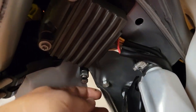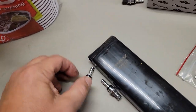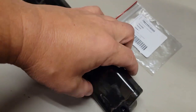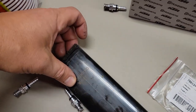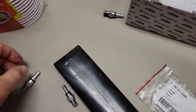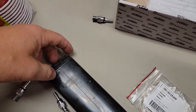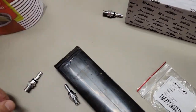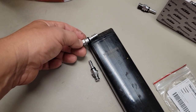Then there's a plug that comes and that goes into this side. It looks just like these barbs except it's a plug, because your coolant goes in through the bottom to fill this reservoir. And then if it gets too full, it'll come out this port and then go out. So it goes in here to fill and then it can still come out here if it needs to. The plug is just because there's no purpose for that last hole.